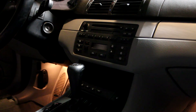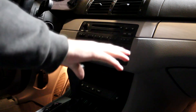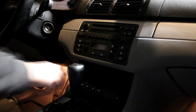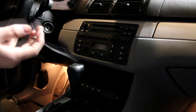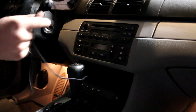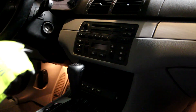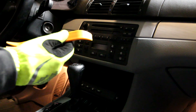In the process of removing the radio, we have to get rid of these two trim pieces right here because they're both separate from each other. If you're going to be replacing the radio with a single-DIN radio, you just take out the radio. If it's going to be a double-DIN, you're going to have to do the HVAC relocation, which is what I'm going to be doing but not in this video. I installed an auxiliary — if you're going to install an auxiliary, you can only do it in the 2003 and newer E46 models, and I'll show you how to do that as well in this video. First thing you're going to want to do is remove these trim pieces. I have my favorite tool, which is the skin wedge — it's used for pulling aluminum siding off of airplanes but it's also really helpful in automotive. I'm not actually going to use that on this because I would rather use an actual trim tool.